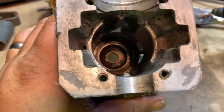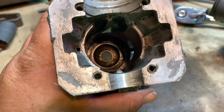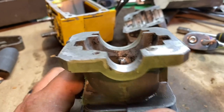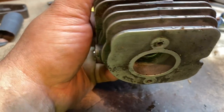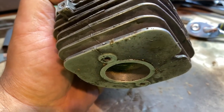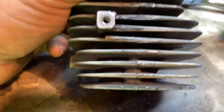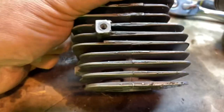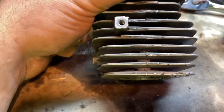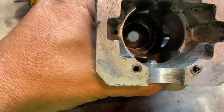Being that this is a clamshell, that just makes things a lot more difficult. There are basically two methods you can use: take it off the base and redo your bearing pockets, or take it off the top and cut yourself a new head. It's a pretty extreme modification — you've got to cut the top off, machine a head, and all that stuff. If you adjust off the base, you're going to affect your intake timing, your transfers, your blowdown — everything.